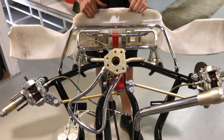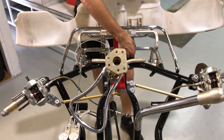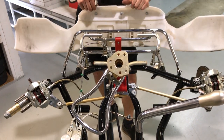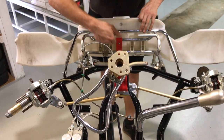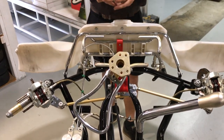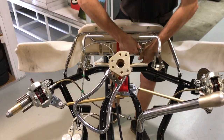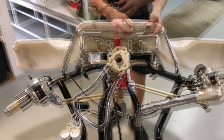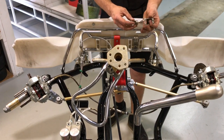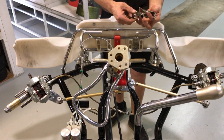To insert the nose cone onto the car it's pretty easy — just pull the clamps all the way off. If you leave them on but loose it can make it really hard to get it in. When you take the clamps all the way off you can get it in there, push the nose cone or the front bar down, and then just put the clip on — it's an over-center clip. These are adjustable too, so if it's not tight when you do the over-center part of the clamp, just screw it in a couple of times until it's tight on the bar.